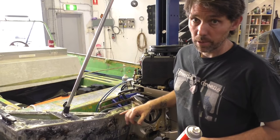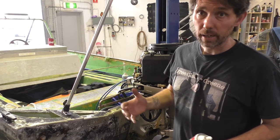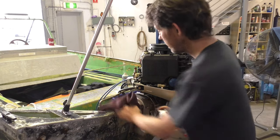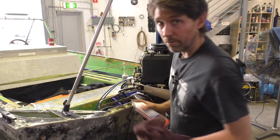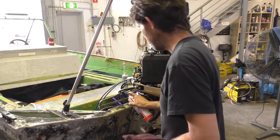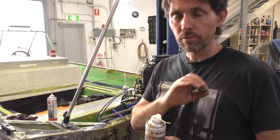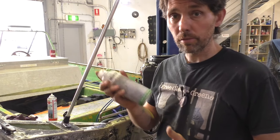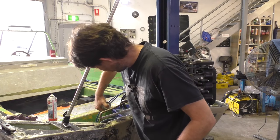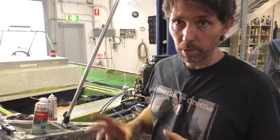Another really important point when it comes to greasing is the cable steer. As you saw last week, they can get badly corroded. So before putting this away, I'd spray a bit of carb cleaner and clean the rod up itself — no real need to take it out, just clean it with it fully turned to starboard so it's extended. Once the grease is off, just re-lubricate that rod with a bit of white lithium grease. Then wind the cable all the way in so it's not exposed.